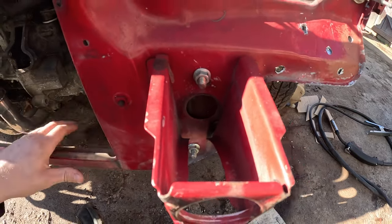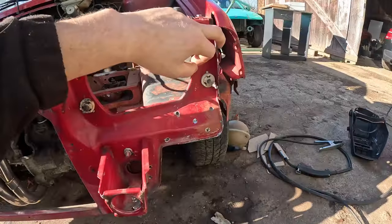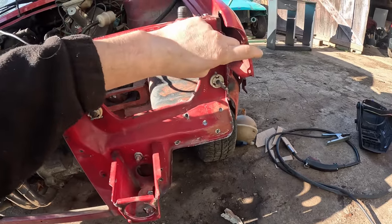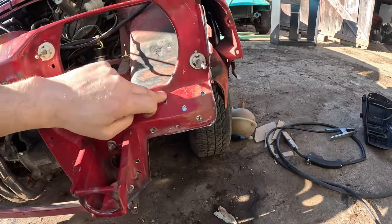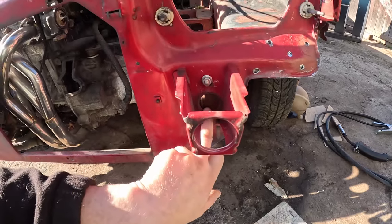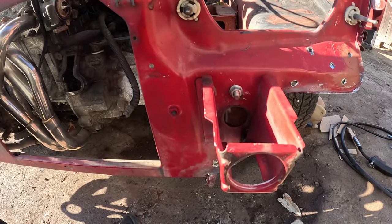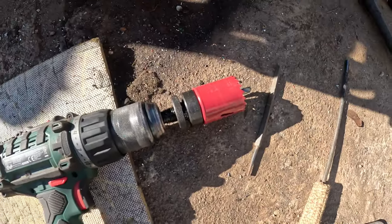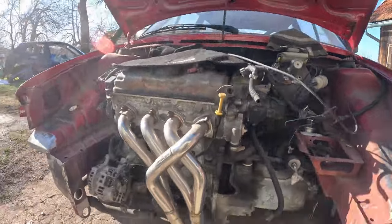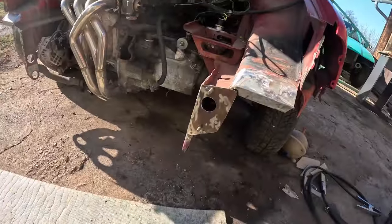First two bolts holding on. As I mentioned, this really needs to be reinforced. I need to straighten this out a bit more, get it to work with the headlight, blinker, side repeater. I need to plug all of these holes and I will make a hole right here so I can protect the chassis leg with wax or whatever we put in there. Now let's do that over here — after we fit that, and before that we need to drill the holes and repeat everything we did on this side.